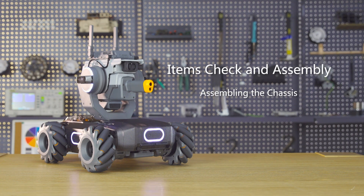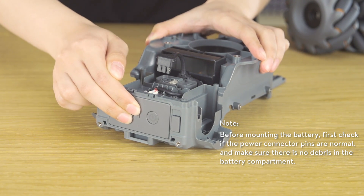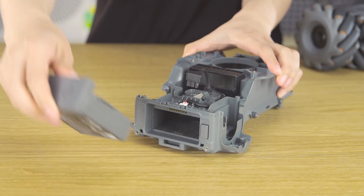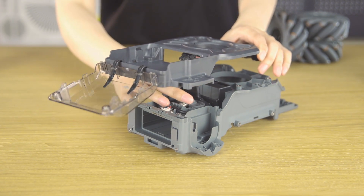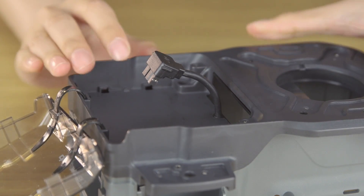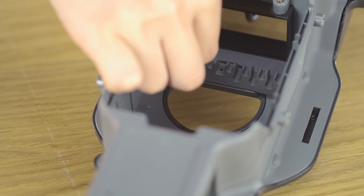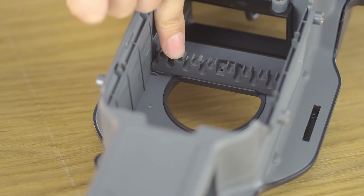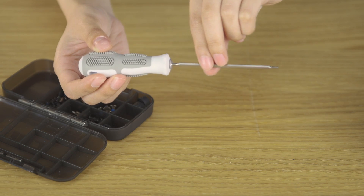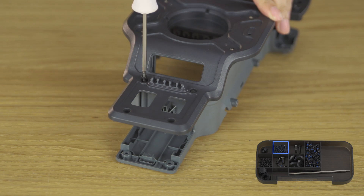Step 2: Assembling the chassis. Check to make sure the battery eject button is functioning properly by inserting and ejecting the battery. Attach the chassis middle frame and chassis cover, making sure to pull the power cable through the chassis cover's hole. Turn the module over. Mount the cable retainer to fix the cables, pressing both ends down to ensure it is mounted securely. Secure the T2 screw, then secure six T3 screws with the screwdriver bit's larger end.